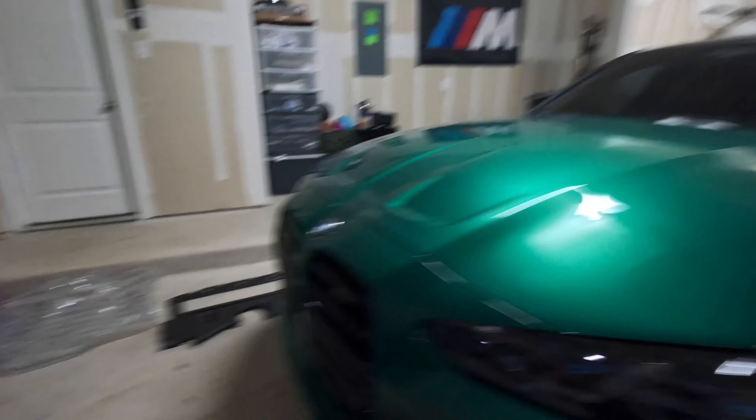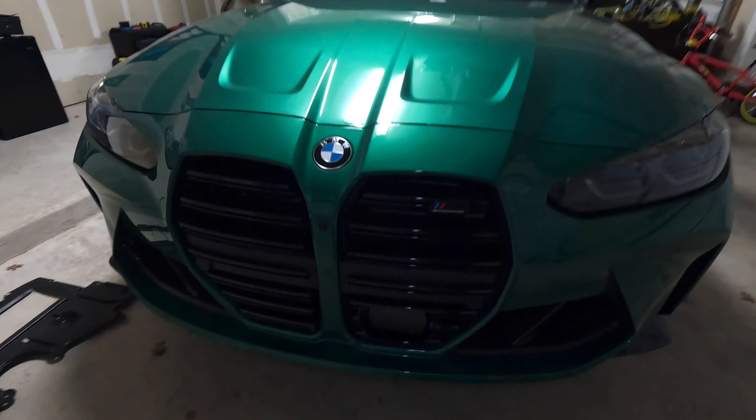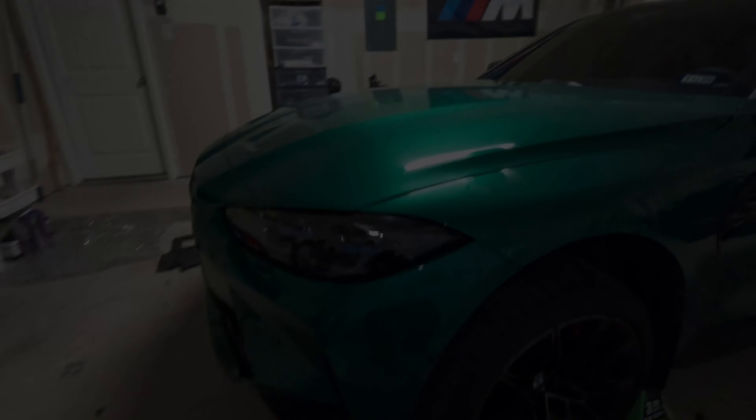This is what it looks like. So you see — as far as any replacement bolts, they did provide seven bolts in total, and that's for securing the skid plate. It actually goes up to here. I did have to exchange the stock hardware for this one. Before it had the rubber lip, now it has this metal lip — still protecting and not just straight through.